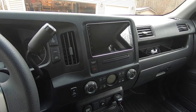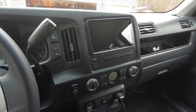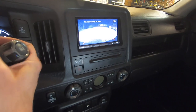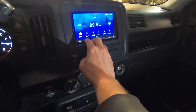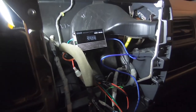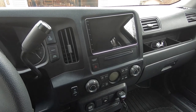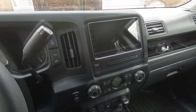The factory RTS came with a subwoofer, just like the RTL, but the factory subwoofer is not very good. I first set out to retain the factory subwoofer and installed a Sony XAV-AX5000, which is a popular choice for this vehicle. You just order the dash kit, the wiring harness, and the unit. I retained the factory amplifier and used a small Boss amp behind the head unit, though I don't recommend that amp because it had a lot of problems.